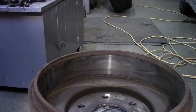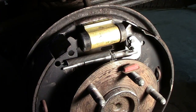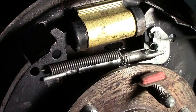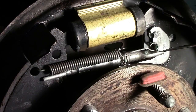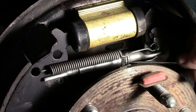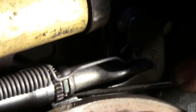We're on the side where the adjuster is exposed. We've already taken the drum assembly off of this side, and down in between we can see the self-adjusting mechanism — this component here — where it has a fulcrum point. The strut rod below the lever goes up and down, literally moving the adjuster up and down as it operates.